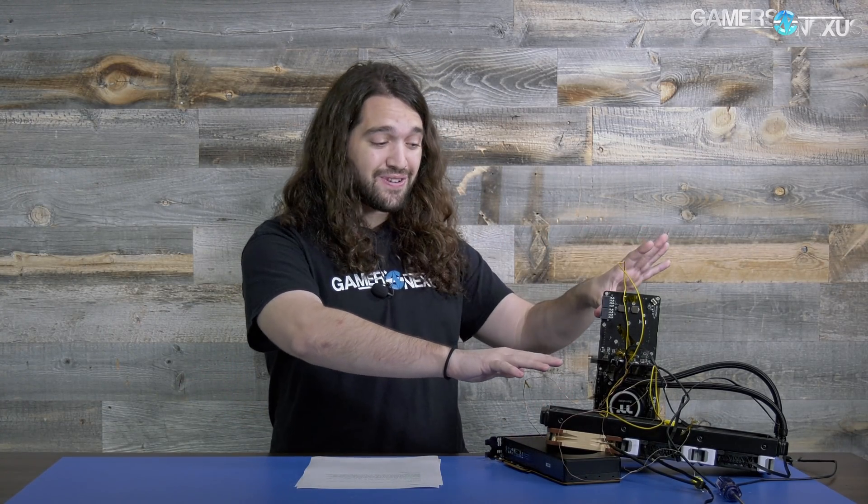Key takeaways: compute units matter a lot less than frequency. If you're choosing between Vega 56 overclocked versus Vega 64 stock, go with the Vega 56. Even considering overclocking the 64, both cards cap out at roughly the same area. Vega 64 just doesn't have a place in the market when the 56 performs so well — with just a 50 offset and five minutes of overclocking, no cables or registry edits, you can match or slightly outperform Vega 64. Vega 56 looks pretty good once you start pushing it.